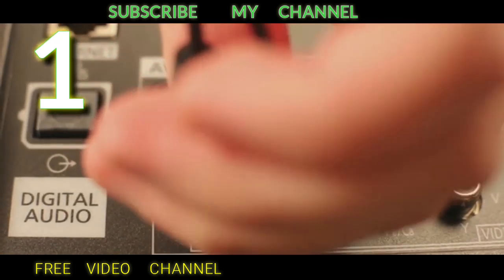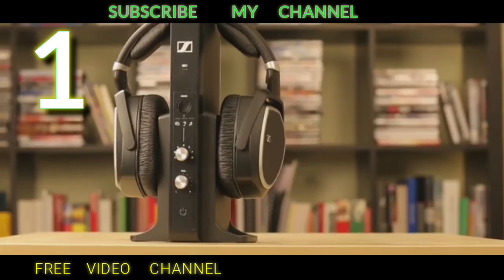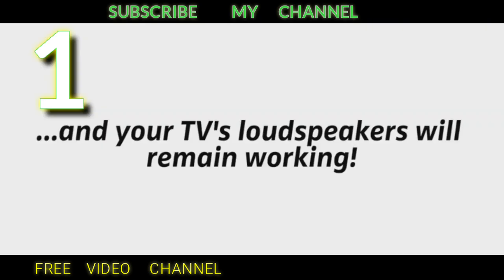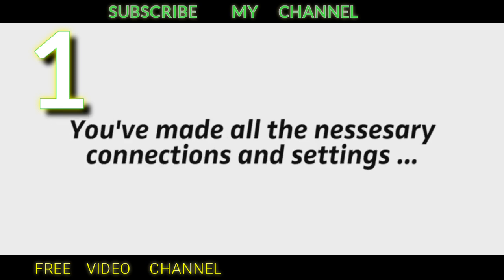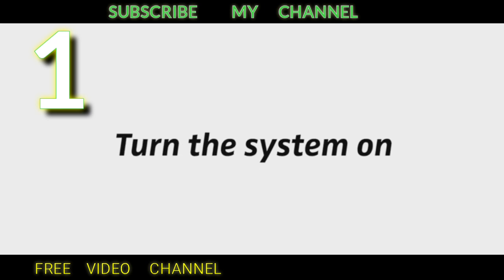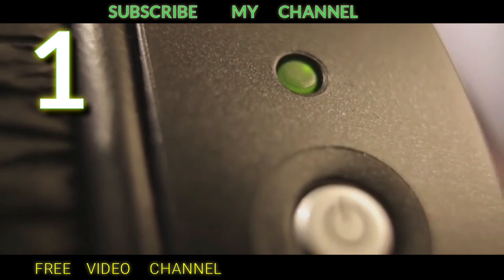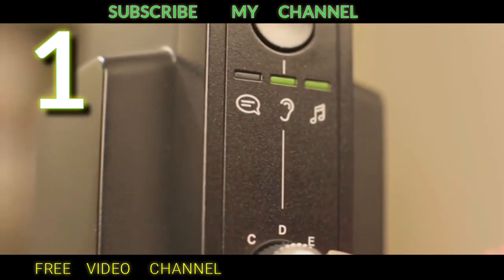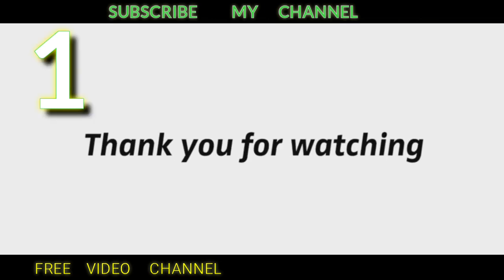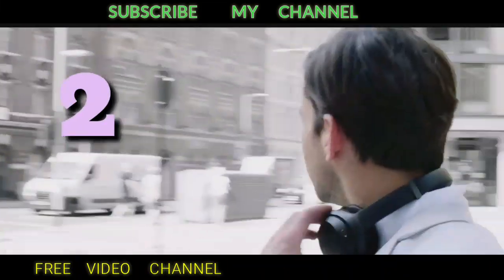Connect the adapter to the TV and the audio cable onto the adapter. Connect your RS 195 like this and your TV's loudspeakers will remain working. Once all connections and settings are made, press the power button on the headphones for about two seconds — this turns on both the headphones and the transmitter. You can now try out the various sound settings.